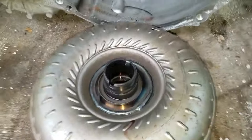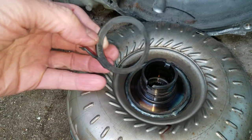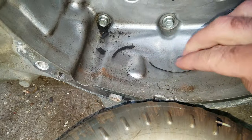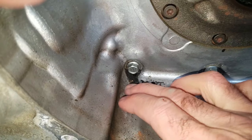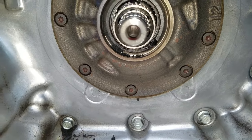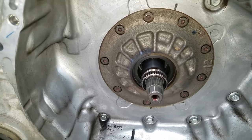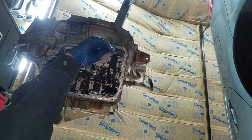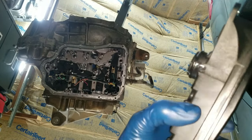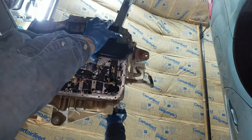So I found the problem. The bushing for the transmission for this torque converter is stuck on the converter, and the seal is burnt to a crisp. Here's the bushing right there — that's supposed to be in here. The spring for the seal is just laying down in the transmission and all the rubber for the seal is just burnt to a crisp. That's why you put a dipstick tube on a transmission — they say you never have to check it, well if it's low, you do. I've never seen anything like that. They took the filter out of it and left the two bolts for the filter in here. I went out and got a tranny filter kit — the kit didn't come with an O-ring. There's an O-ring right here, so I had to take the other transmission apart to get the O-ring because it wasn't in this one.